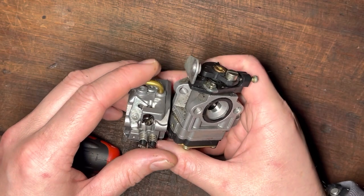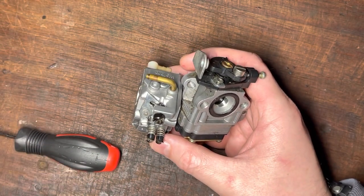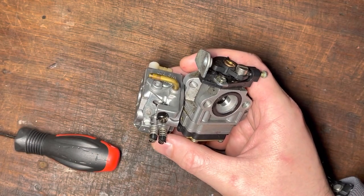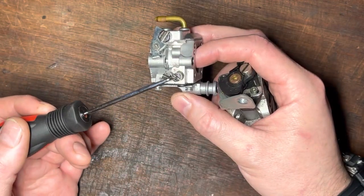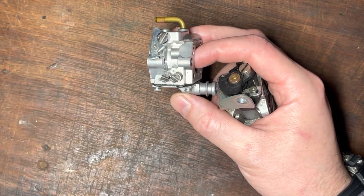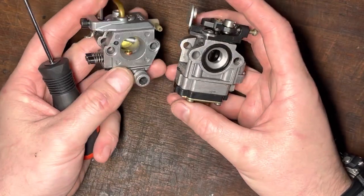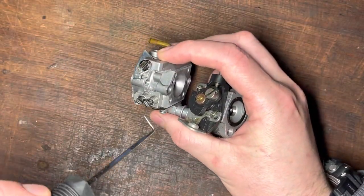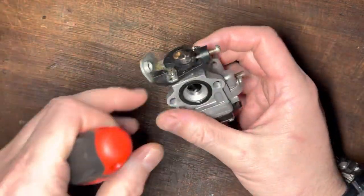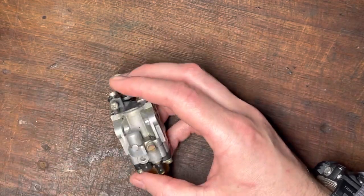What happens when you pull that trigger, get up to nearly full throttle, and then the engine is lacking power, doesn't run well, and may want to die? That's a high-speed fuel supply issue — it's lacking fuel. If the engine wants to die when you've got it pinned and it's not reaching full throttle and running poorly, just open the high-speed screw until you start to hear the engine four-stroke. That's your high-speed screw on this style carburetor — pin that trigger, open it until you hear it four-stroke.